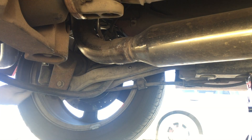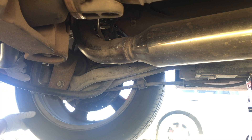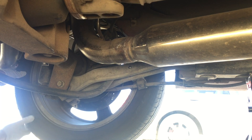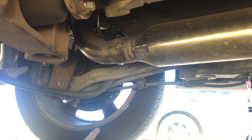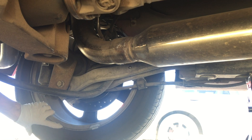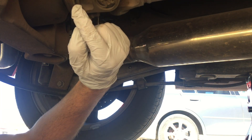We're going to rotate the wheel one full revolution and count how many times the drive shaft spins. It helps if you have another person, but you can do this alone. We count one, two, three — okay, here comes our line — there's four, and we just have a little ways to go to get to that full rotation, so we're going to go four and then right about there. Right about there is where we started again, so now we just need to know the extra from here to the very bottom.